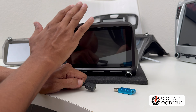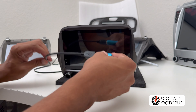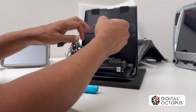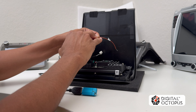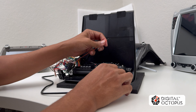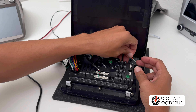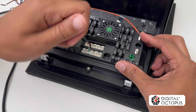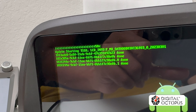Back to the radio. The first thing to do is make sure the radio is turned off — if it's in the car, shut the key off and take it out. Put the USB into the USB port of the radio. Next, turn the radio over and look for a wire labeled 'Key 1' — it looks like this and is usually orange with a yellow stripe, though it may vary by model.